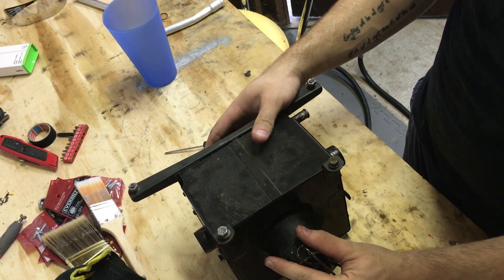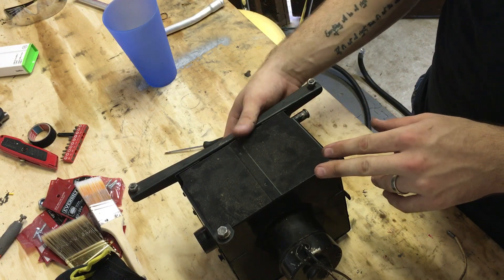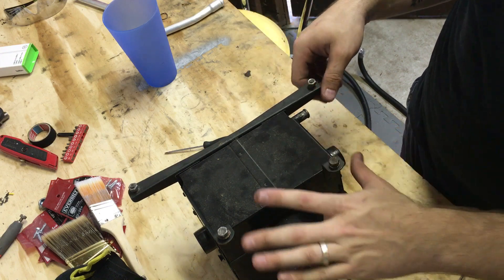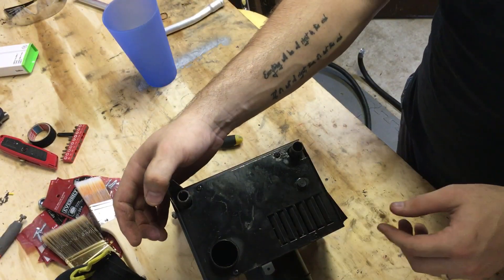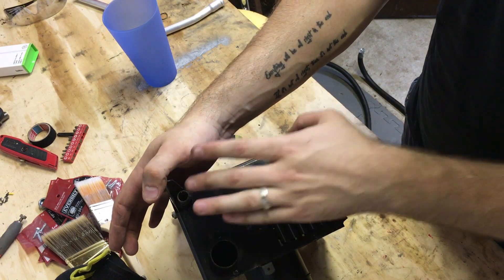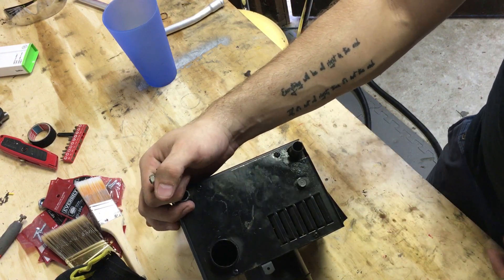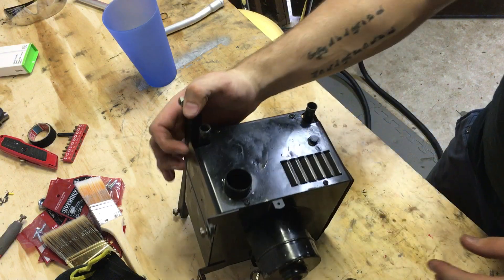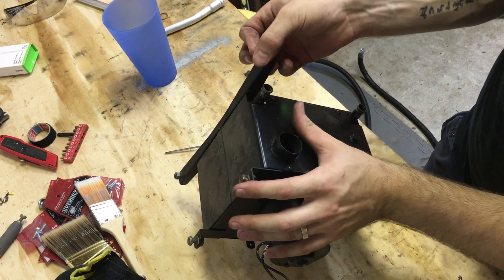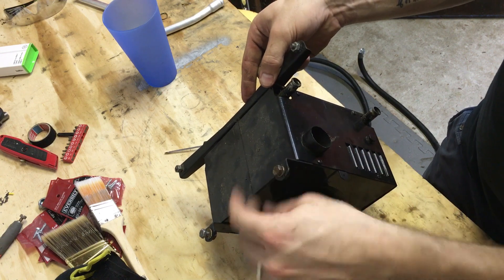That pretty much wraps up these heater cores. They're really simple, really easy to work on. If your core is starting to leak, you can find replacement cores at Seven Enterprises — they sell just about every core. The one on this heater, I don't believe anyone carries anymore; it has two heater lines in line with each other. If you're looking for a core like this, you're going to have to find one that's new old stock, or that came off of someone else's car that doesn't have any cracks in it. Otherwise, you can find replacement heaters — they're kind of uprated, nicer heaters. I believe Seven Enterprises sells that as well, but there are lots of other third-party options out there.